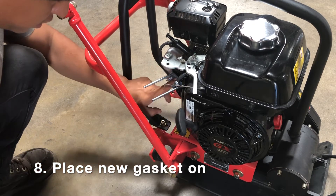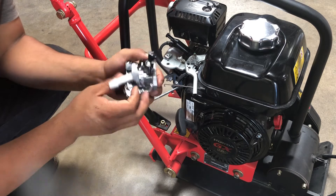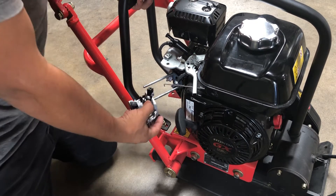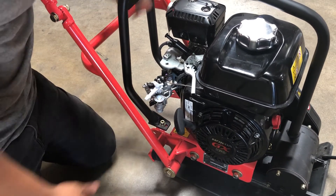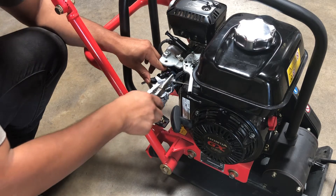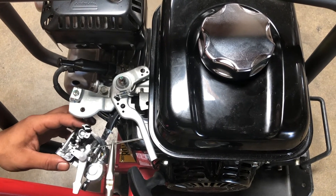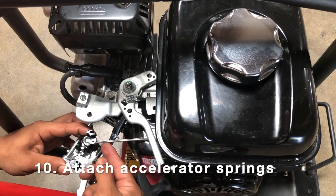They're really sensitive, especially on these. You always got to use good gas, the right amount of oil, don't let too much dirt in, change your air filter. If you're cleaning the carburetor, one of the cheapest ways — I took a Walbro carburetor class — is to just use an ultrasonic cleaner, which is basically just a jewelry cleaner. You can get one at Harbor Freight for like $20. Some people use seafoam, but you've got to really open up the whole carburetor and it doesn't always work. An ultrasonic cleaner works really well — just a little cleaning solution, fill it up with water, put it in and it gets into all that dirt and grime clogging your engine.